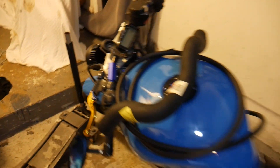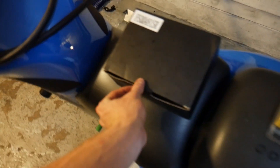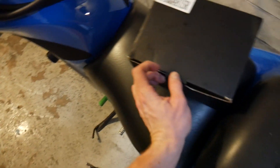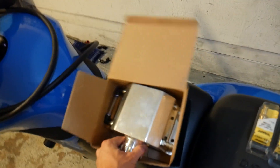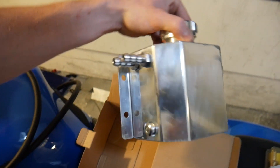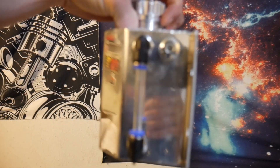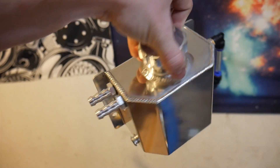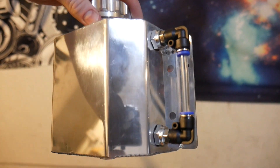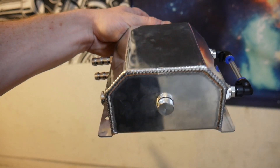We have everything laid out over here on our motorcycle workbench. We have the Speed Lab Auto Parts oil catch can right here — once again shout out to you guys, we really appreciate it. You can find the link to this oil catch can down in the description, and they're running daily deals so you guys can check it out. Check this thing out — it's a polished aluminum unit, pretty badass. You can see it already comes with two connections. We're going to be needing four, and that's no problem because you can remove the capped ports and add additional ports. The whole thing is machine-welded, super secure and sealed. You get a little gauge here so you can see how much oil has accumulated, a cap on top, and a drain on the bottom, making it really easy to empty out.